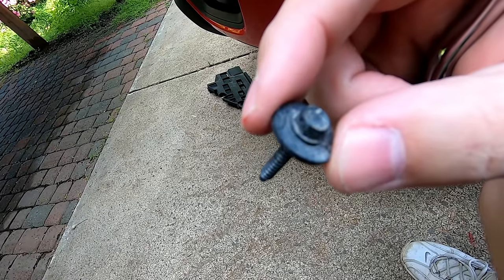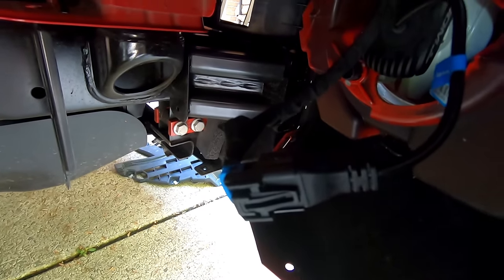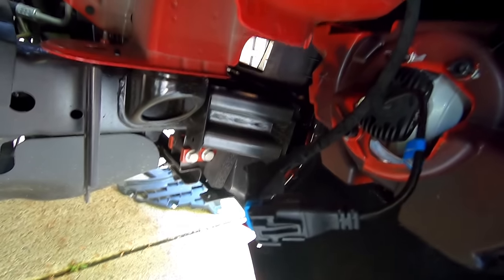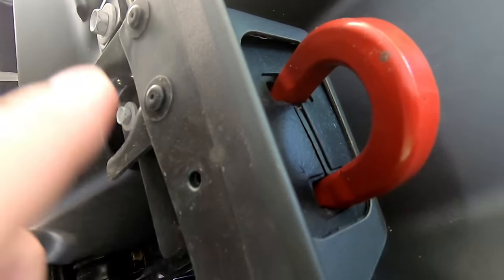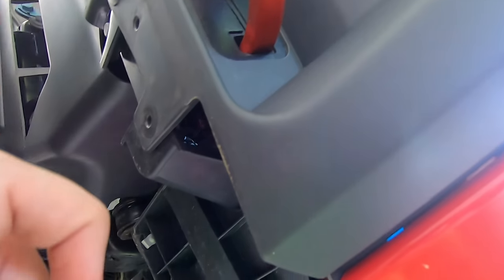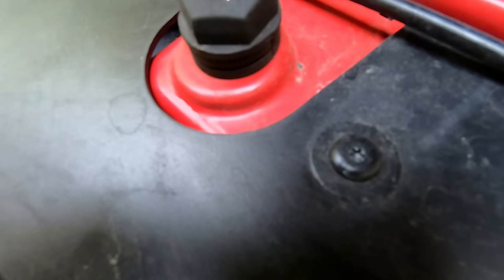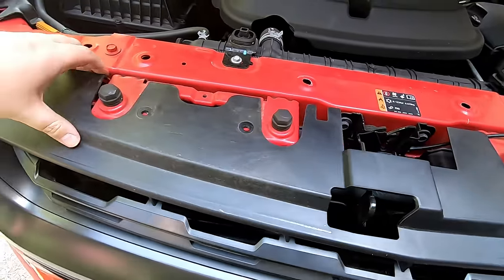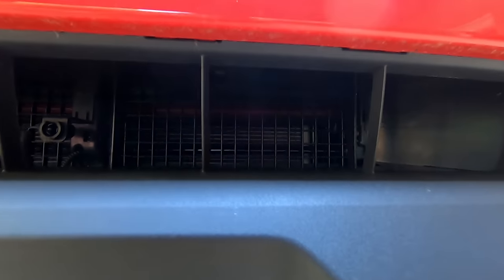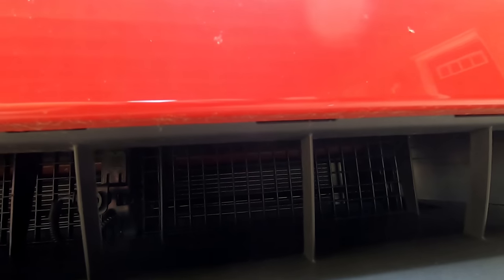There's one bolt out. There's not a lot of room to move a ratchet around, so be prepared for that. This is a 7mm head, and there's three of them per side. Don't forget to unplug your fog light harness if you have fog lights, because those come off with the bumper. There are four T15 screws here and two more on the other side — six all together on the driver's side, and six more on the passenger side. This is just so the bottom of the bumper is free when we go to remove it. Up on top, we have six T15 screws, three on each side. With the bolts out, we can pick up on this and just pull it forward. And lastly, there are two more bolts — you'll need an extension and a 10mm socket to get to them. Once you get these off, the bumper is now ready to be removed.